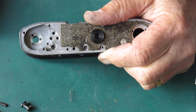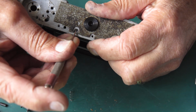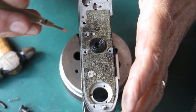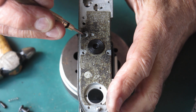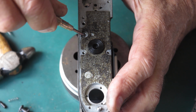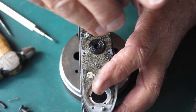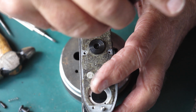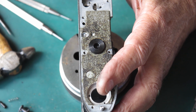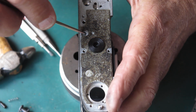Yeah, that's all that was needed. Now this adjustment screw here, see if it'll turn. No, it's locked. Okay, well that screw was locked. Basically it had been wound out all the way, effectively jamming it. It's still stiff, but the lock screw's backed up out of the way, so that's not affecting it. And I got that loose again with the hammer and a heavy screwdriver.